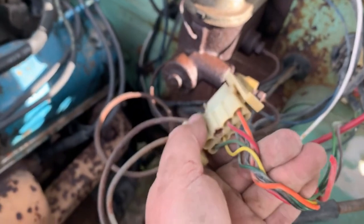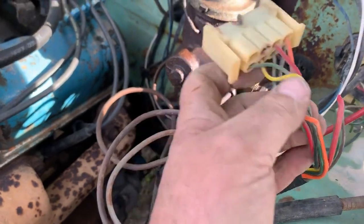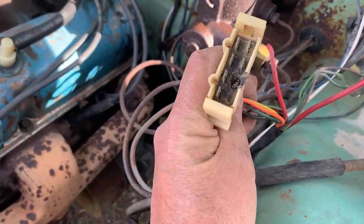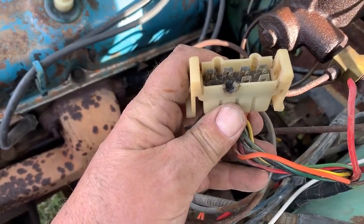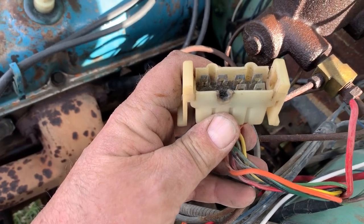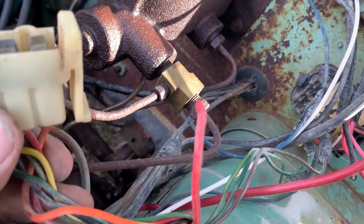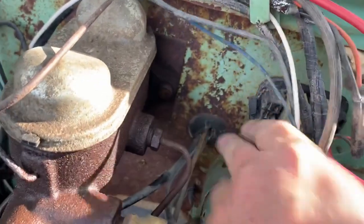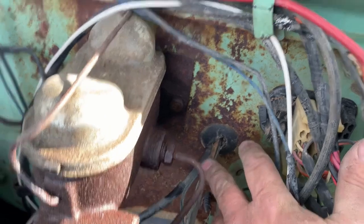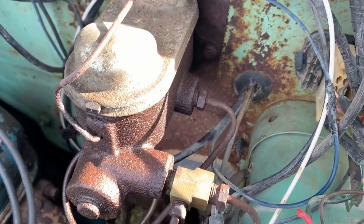This is why it got hot, and why somebody's been in here before me and instead of ditching the ammeter setup, just ran bigger wire to it in a different way. They probably did do a favor by routing straight wire around it, but running it through a grommet that will eventually fail and expose the wire next to a brake line — it's going to abrade through eventually.